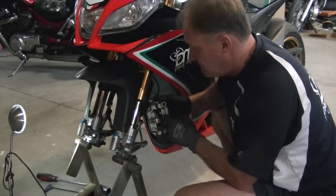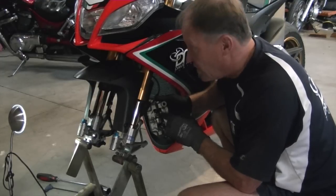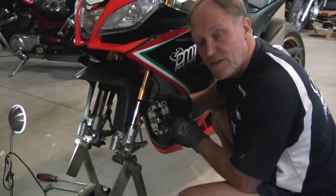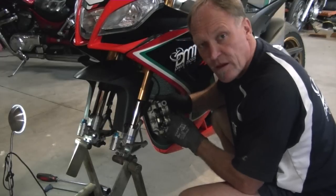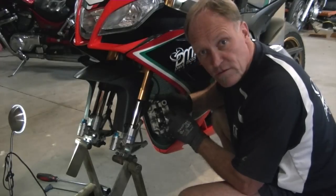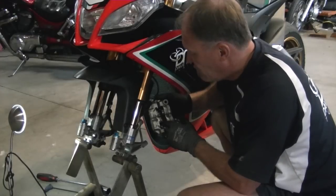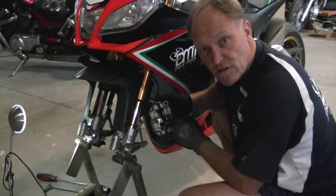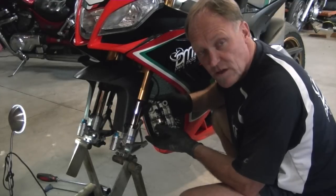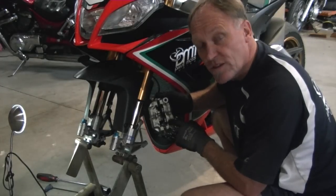For now I'm going to clean these three and hold them in place, and then actually try and free this stuck piston up — get it out and spend a particular amount of time cleaning it. The net result: when I apply the brake lever, all four pistons should come out and move at the same time. They'll move in varying degrees based on how much stiction there is between the piston and the seal, but they should all move. Keep doing this until all four pistons move evenly. Doing that initial squeeze tells you where you need to focus your attention.